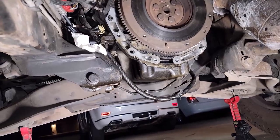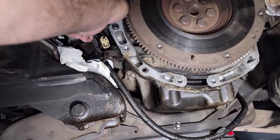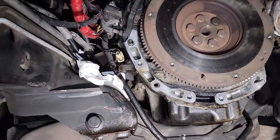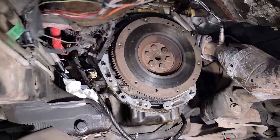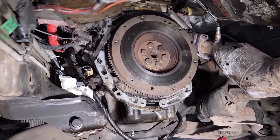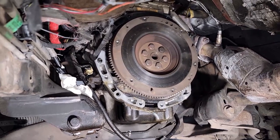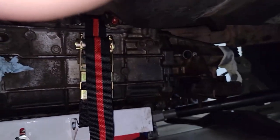This thing does look like it's been starting to leak some oil. I was worried about the rear seal — I heard those do start to go — but looking right here I can see it's slathered at the oil pressure switch, so I should probably pick one of those up too; that's probably what's leaking oil on this thing. I actually had the same thing happen on my F-150, my 2015 — it was throwing a warning light at idle and it was the oil getting into that switch causing it. Those do wear out.